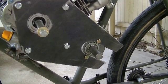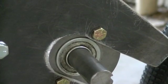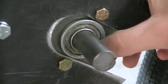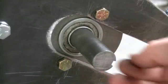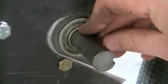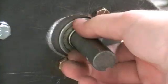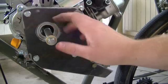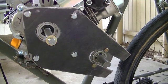As you can see, I got that bearing flange bolted to the engine bracket plate. The only thing left to do is go get the new locking collar to put around the shaft, because as you can see this bearing comes out real easily. So I did get another locking collar for that — I'll go grab it and then we need to put that on, drill a little landing area for the set screw, like we did for all the other sprockets and the other locking collar. Then we'll be done with this part, and all we'll have to do is make the cover that goes around the clutch, chain, and sprocket so you don't get your shorts, pants, or leg flesh stuck in there.